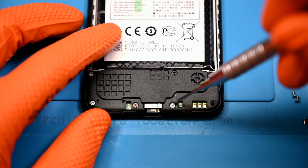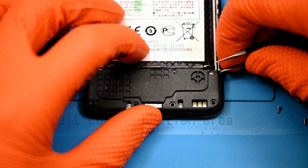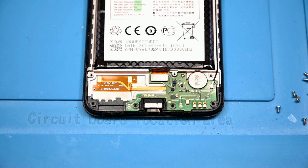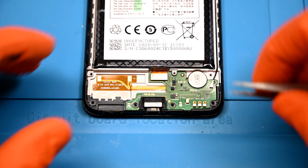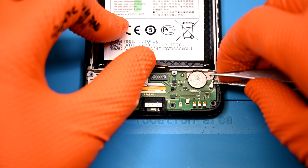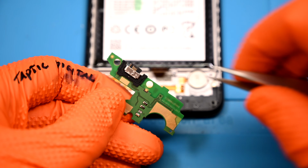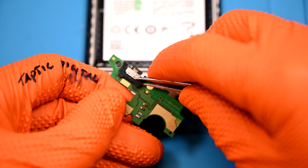Down to the bottom there are 7 more identical screws that need to be removed. The 3 gold contact springs on the right side link to the antenna panels inside the back cover of this device. The charging port itself has a little rubber gasket that provides minimal water resistance. There is a missing contact spring that should connect the antenna, but it seems to have disappeared.